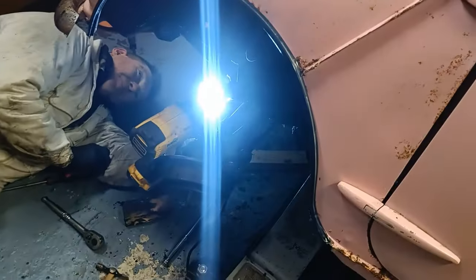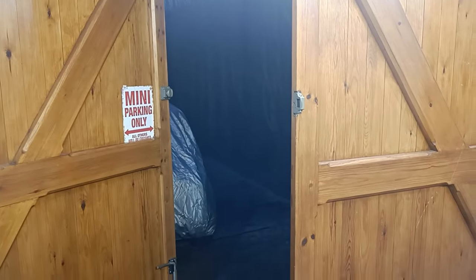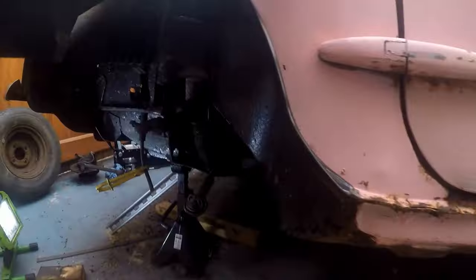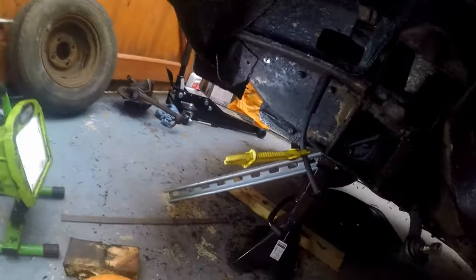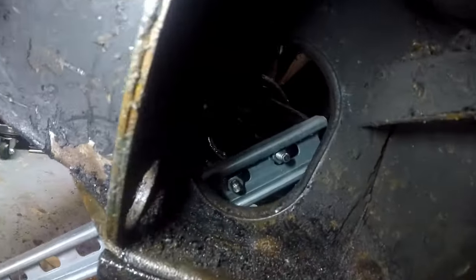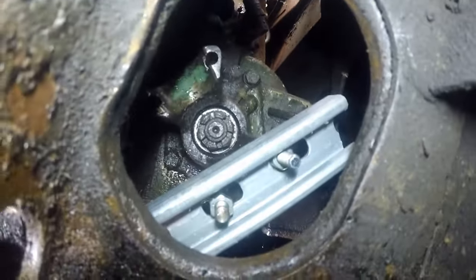As you can now see it's pretty dark outside and Sean has lost the will to live. There's the bolt that goes into the gearbox - we just couldn't get it undone. The Haynes manual says to put a block of wood beside it and press against it, but we just couldn't do it. So the next day I'm on my own and I came up with this genius idea - put a bit of uni strut across two bolts through the drive flange to where that nut is, and I got it undone - yay!